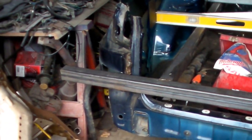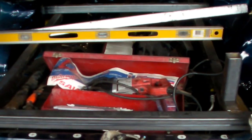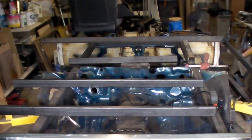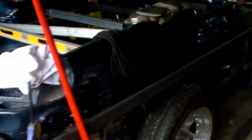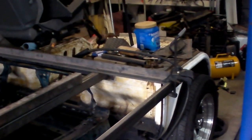I have been working on the van. Here you can see the crossbar. That's going to be the total width, 70 inches of the bed. I've got two rails going from the back all the way up to the front, welded to the Volkswagen. There'll be cross members in it. Let me walk around here. This is a 1x2, which would be running the length of the bed. This has to be removable, so after the body is built, I can remove it so I can gel coat and fiberglass it.